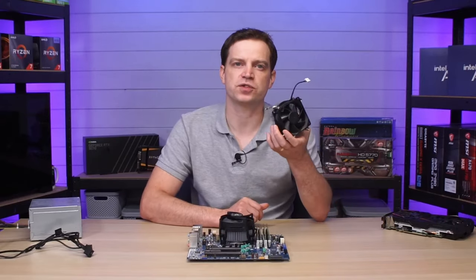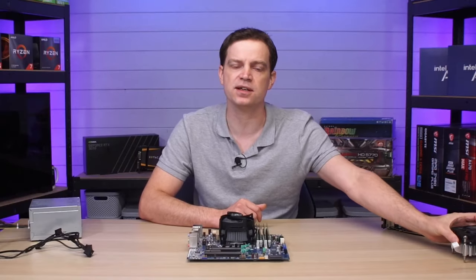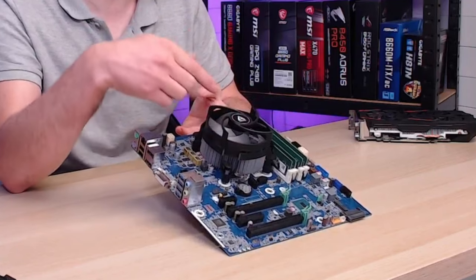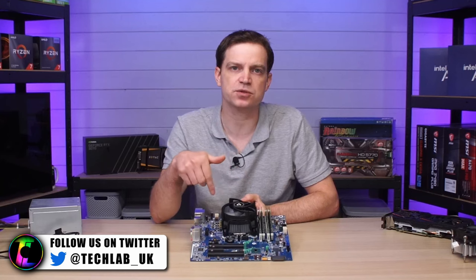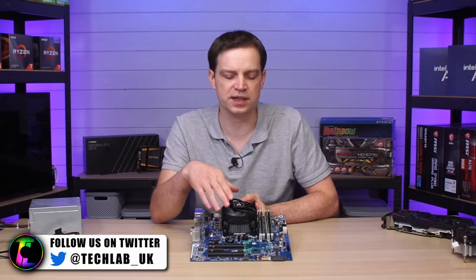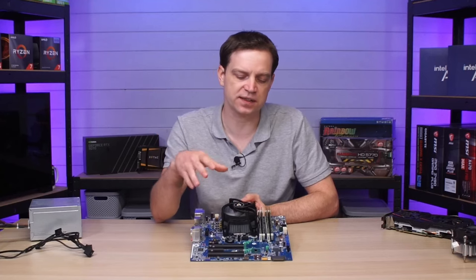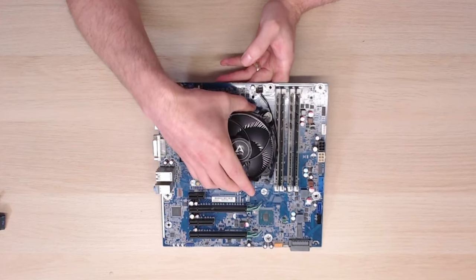The first proprietary issue was the fan. In the HP Z240 standard case, the mounting points for the fan are actually in the case itself, so we can't take that along because there's no way of actually mounting it to the CPU. Instead we decided to swap it out for a basic cooler from Arctic. You can pretty much get away with any cooler you want on here because the mounting format is pretty standard for Intel - a tower cooler, an AIO, pretty much anything - but we opted for this because it's cheap, reasonably quiet, and it will do the job.